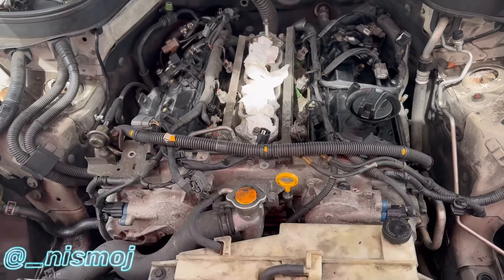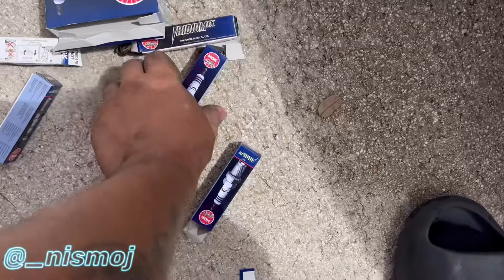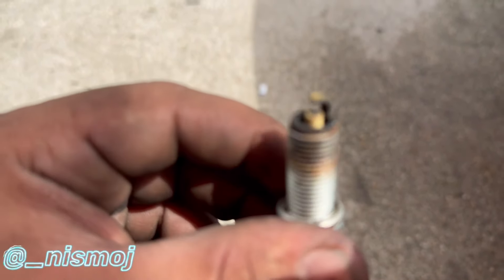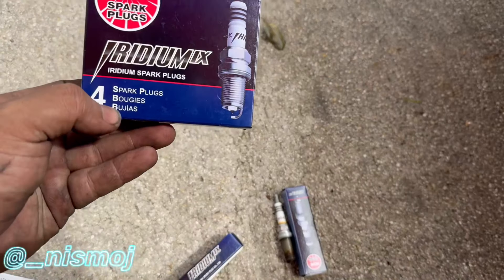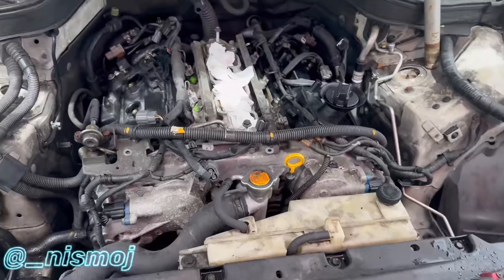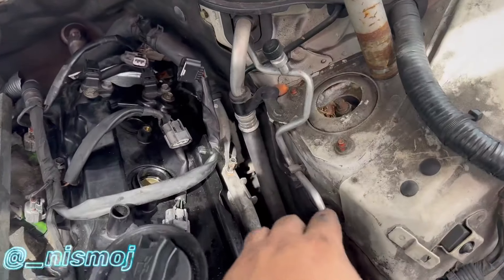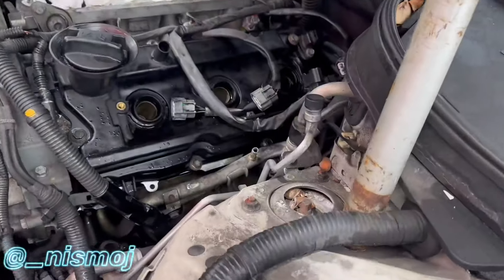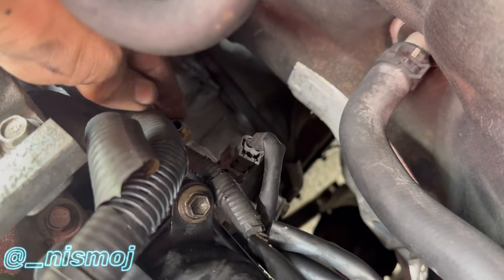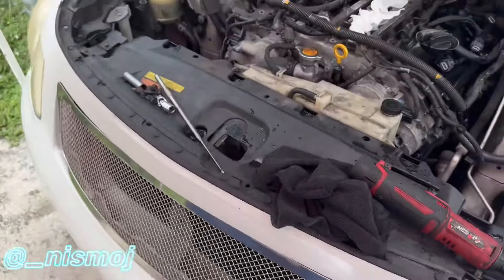Sorry the quality changed - I'm using my phone now because my GoPro is dying. I got the valve covers on, already got my new plugs on. The NGK plugs - about 65 bucks, OEM spec, come pre-gapped. Now I just got to put the coil packs on and do the bypass for the throttle body lines I deleted. You connect this hose here to this port right here and that's it - all those lines get deleted.